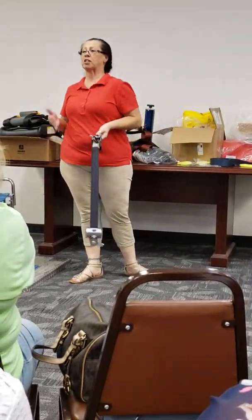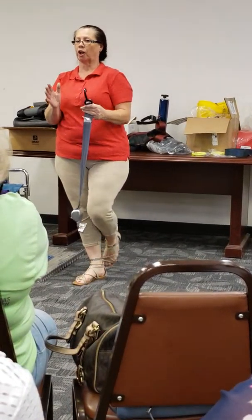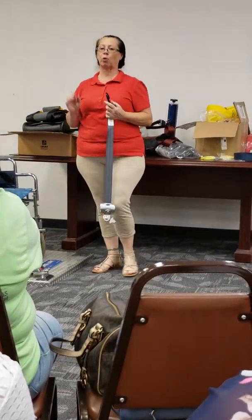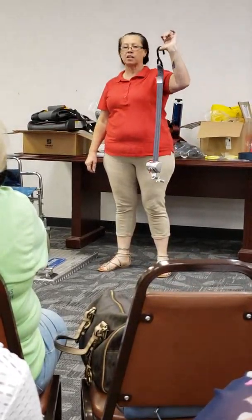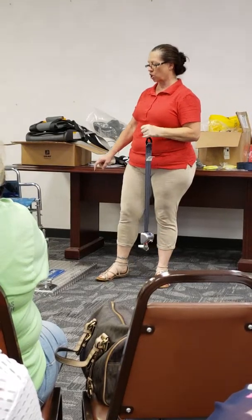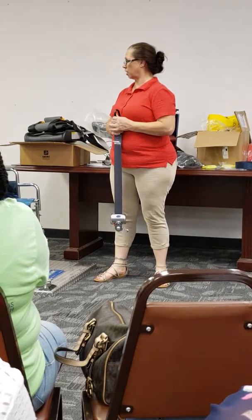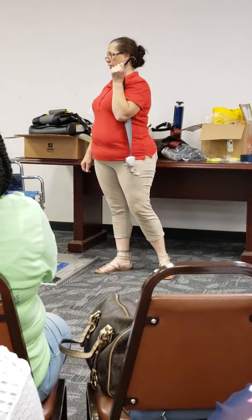Okay, so, wheelchair securements. This is a wheelchair securement. This is not for the passenger, this is for the chair. Wheelchair securements went from aisle facing to forward facing in 1991, because they determined at that time it would be safer in a crash test for the centrifugal force to be on your body as you're facing forward, pulling you front and back instead of trying to pull you from the side, because our bodies are not meant to make that movement. So that's when we flipped forward. We have a 7-point tie down. Four are for the chair itself. This has nothing to do with the passenger. We have to make sure that chair does not move, period.